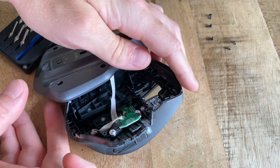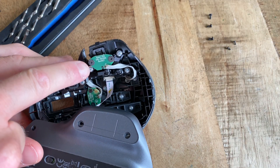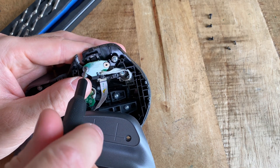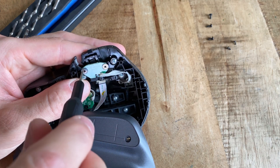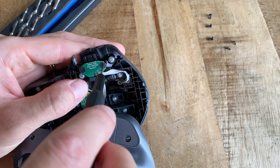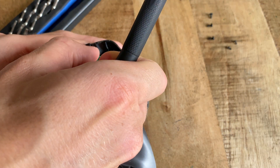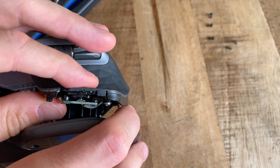After some positioning, we can now see the two small Phillips screws under the thumb button that we are going to slightly loosen. You should then be able to feel the click from the thumb button again if you try clicking it. In my case I also had to slightly wiggle the green circuit board underneath the button to make it snap back into place.